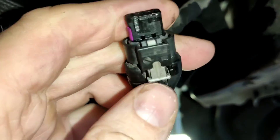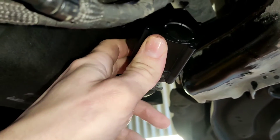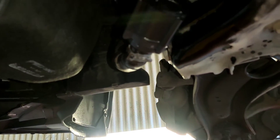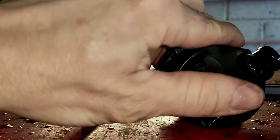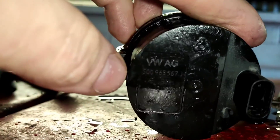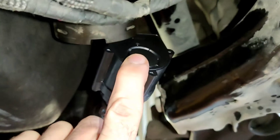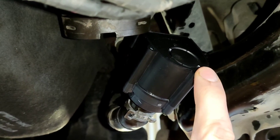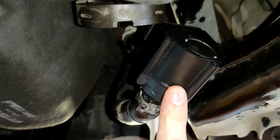Make sure you push the gray lock back in — that locks it in place to stop it coming off. It's pretty easy. You're going to have to top up your coolant and get the car to running temperature. You can also run the part number from the new box through diagnostics, and you may need to get the car up to temperature and run diagnostics to bleed it.